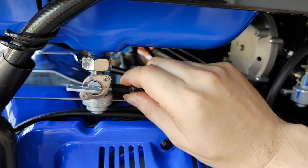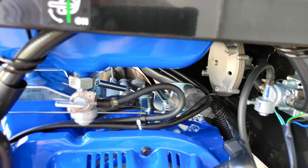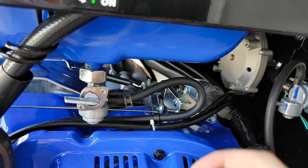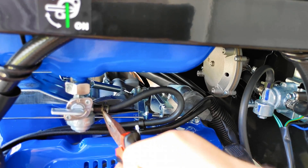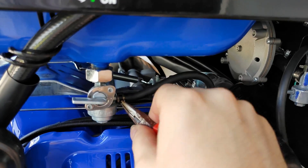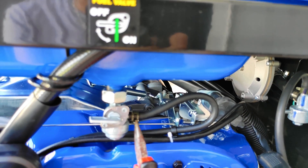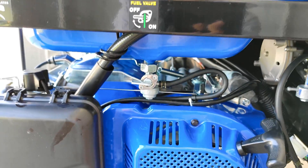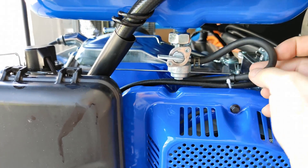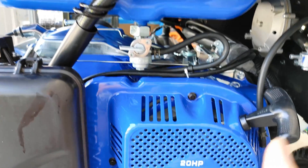In order to bypass this switch, you're just going to connect the carburetor line directly to the fuel tank. Put the hose clamp back in. I'm doing this one-handed so it might be a bit difficult. Just put this in there — there we go. So that is the bypass. Now you've got the fuel tank line connected directly to the carburetor.